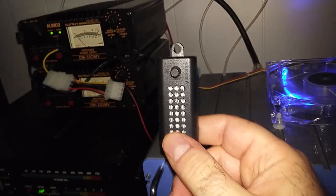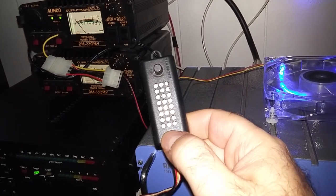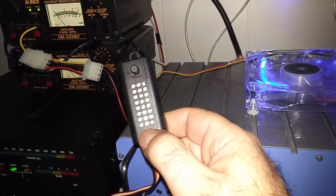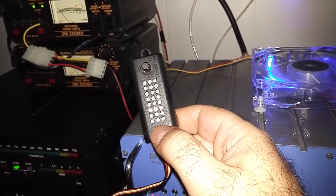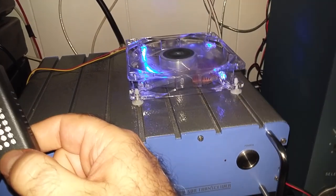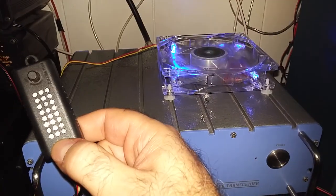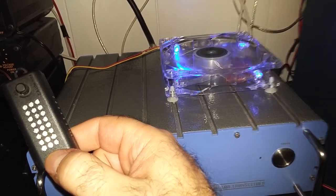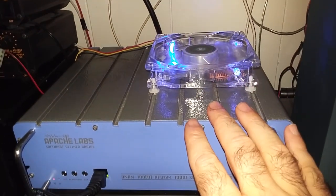This fan is running at its lowest speed. I got hold of an old-school computer fan controller — in this case I had one laying around — though you can also use those speed-limiting resistors that they sell with various fan packages. I brought the speed down to next to nothing, which means there's no noise, no whoosh, and no air blowing off the top to bother me, since I sit with this unit off to my right-hand side.